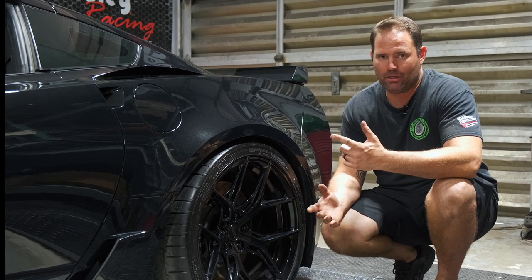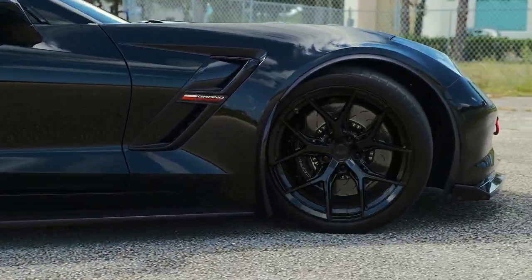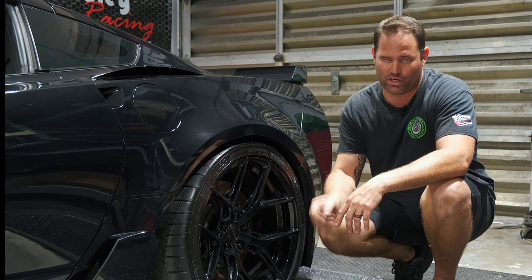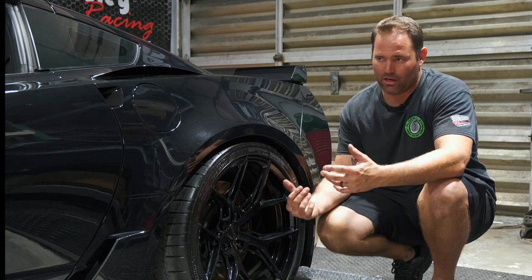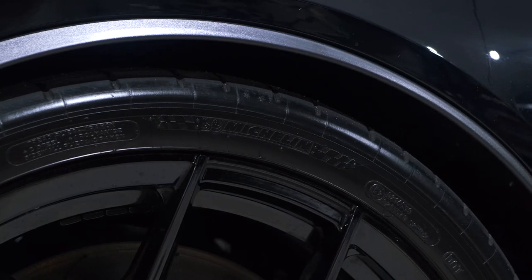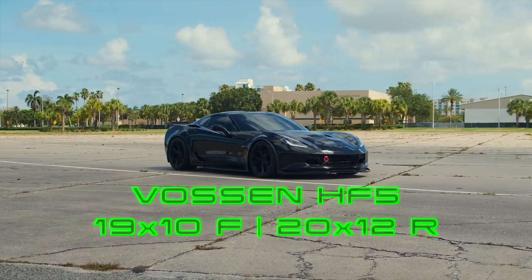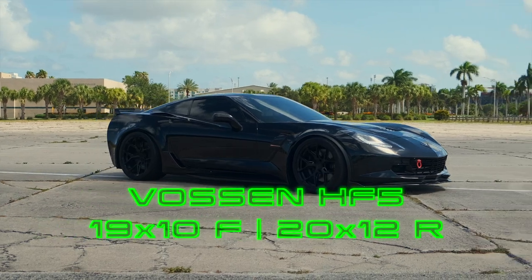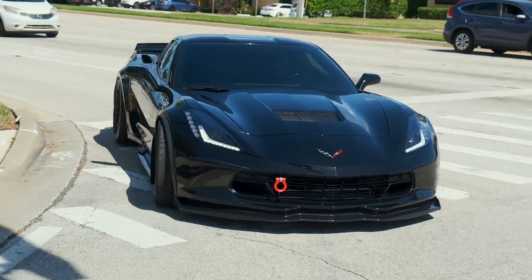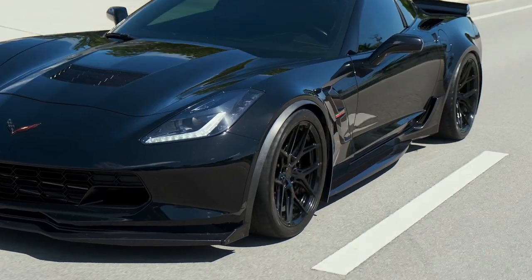While the car was here and we were modifying the engine, Jimmy was also interested in putting a set of wheels on the car and lowering it. You'll notice the car sits a lot lower than it does from the factory. We achieved that stance with a set of lowering bolts — the same concept as fifth and sixth generation Corvettes, a couple of bolts at the end of the leaf spring. These are aftermarket bolts so we got even more of a drop. As far as the wheels, Jimmy picked out a set of HF5s from our friends at Vossen down in Miami. They fit this car really well, almost have that OEM look with the multiple spokes, have a really aggressive concave offset in the rear, and we had them powder coated gloss black. It absolutely tied this entire build together.